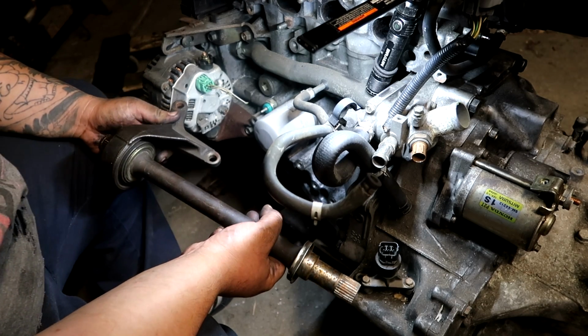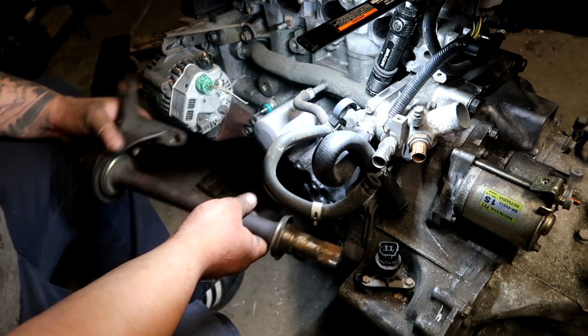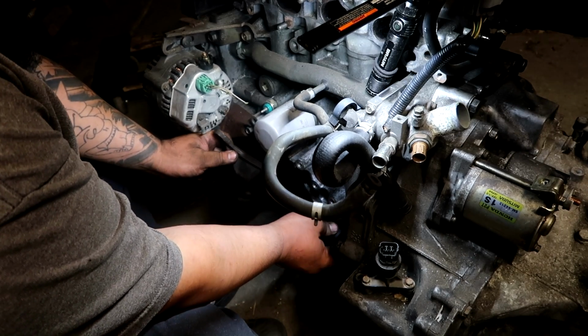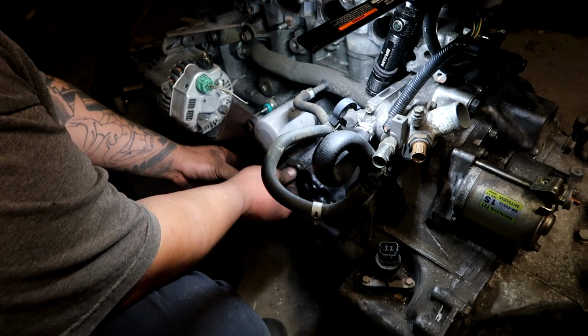So if you're using 94-01, make sure you get the 94-01 seal. If you're using 90-93, 90-93 seals. So this is a hydraulic transmission which has the correct seal, I'm certain, and this is the 94 plus half shaft. So go ahead and bolt this in place.